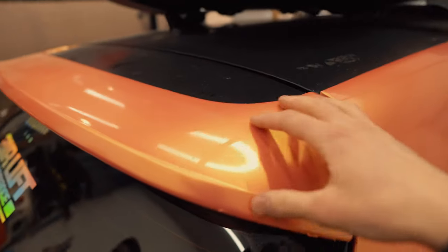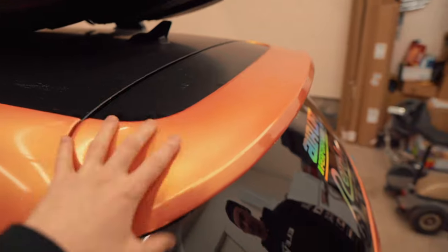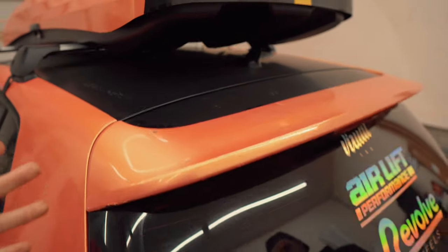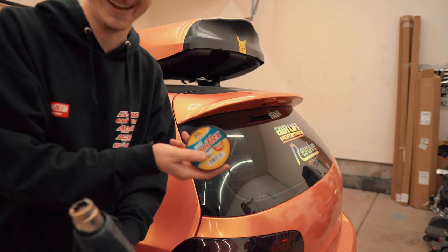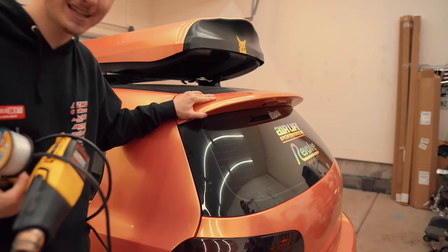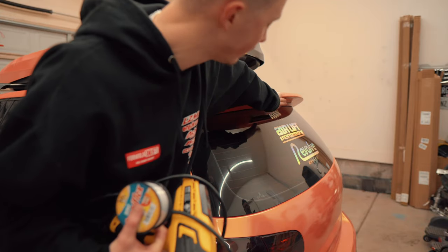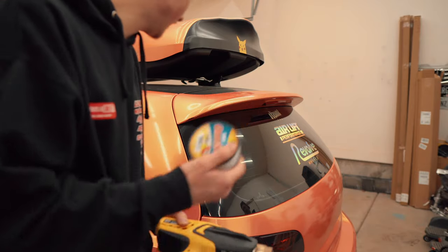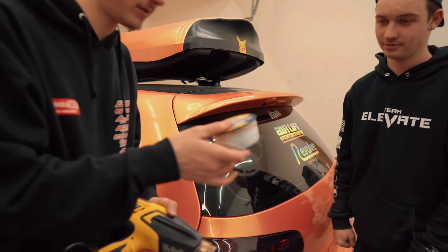Today we are going to be removing this, or figure out how to remove this — there's no videos on YouTube. So if you're looking to repaint your car or change this piece out like we're trying to do, because the wing that I got fits to what's underneath here and won't fit up to this, I'm just going to help you guys figure out how to remove it. We're going to be using the Home Depot special heat gun and some fishing line. From what I've read on the forums, there's a big glob of adhesive on each side on this curvature, and then there's going to be brackets all the way down. It's going to be way easier with two people — have one person heating.